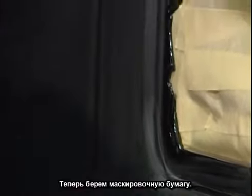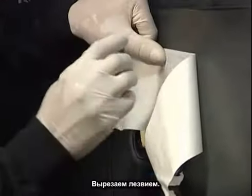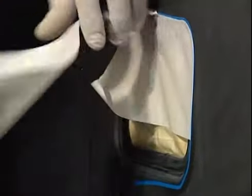And after that, I take masking paper, adhesive-sided masking paper, which is also transfer right masking paper, just to keep the overspray from behind the fine line tape. Straight razor blade, be careful how you cut. You don't want to slice into the surface of the vehicle. It's best to use a brand new razor blade. And that's what you'll have. You'll have that covered like that.